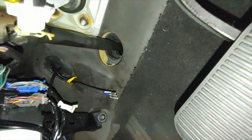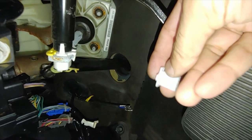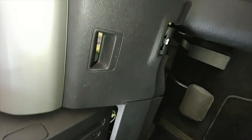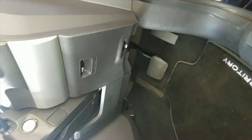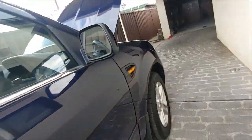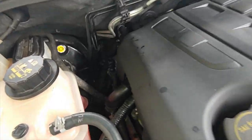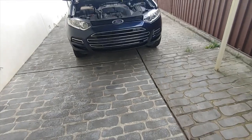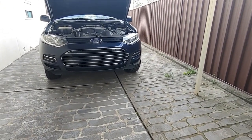Inside the cabin we have the cables coming through. I need to reconnect the connector and mount the switch. I'm thinking of putting a hole somewhere here on the dash — the airbag is over there and this is the fuse box cover, so this looks like an appropriate place for the switch. The result is totally clean — no visible wires, no junk. In the engine bay you can't see any extra wires running anywhere. Everything comes in and goes down from here, and from the front you won't be able to see the LEDs — it's just a subtle aid.